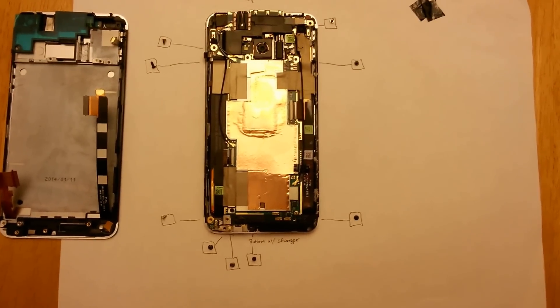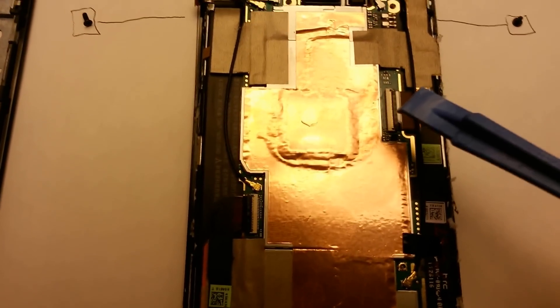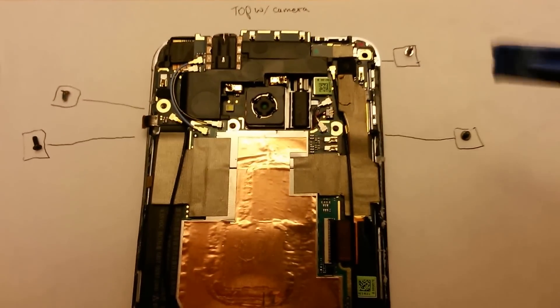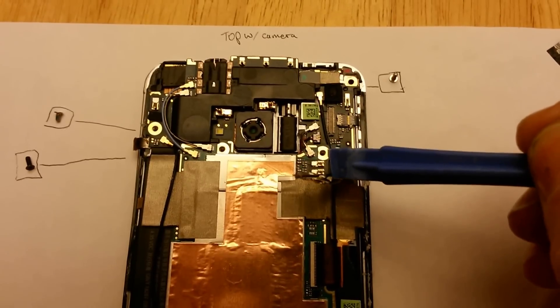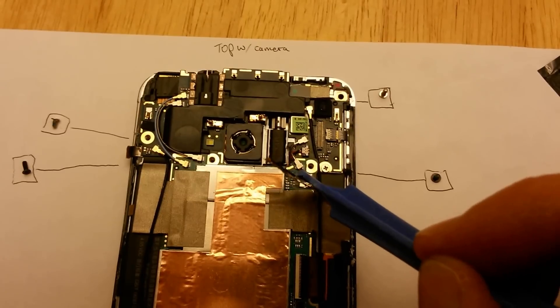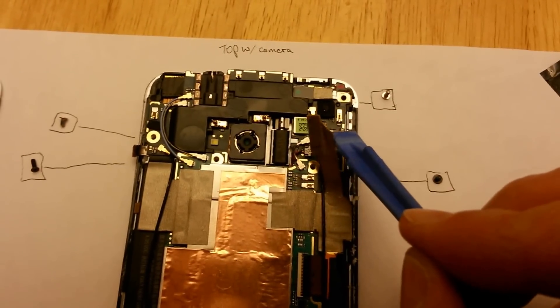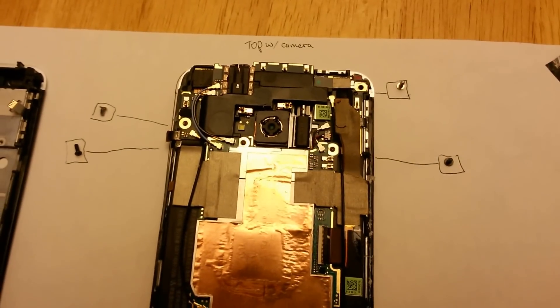The biggest thing to note is where the wires are. You'll need to remove some of the black electrical tape covering the wires — they're right here and here, and one is hidden under a connection that goes through a ribbon cable. You just pull up on that connector piece and you can see how it connects. There are two things to get under here: a screw connecting the guts to the base, and a ribbon cable next to the connection. We'll detach that, get the screw out, and then that whole piece should be able to transfer over to the new digitizer.